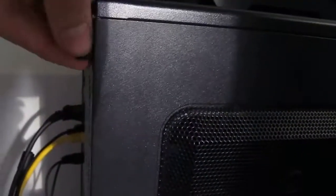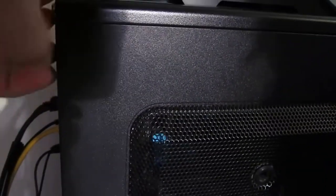One of the most important things before you start fiddling around with things in your computer is to turn it off. Make sure it's not on first, turn it off at the back, and unplug it. This is important because if you're fiddling around with something that's plugged into a power supply, you can very easily either ruin the equipment you're using or even electrocute yourself.